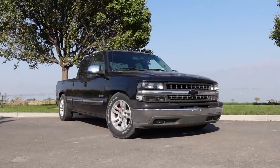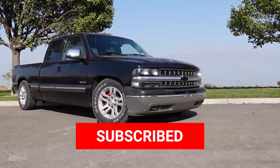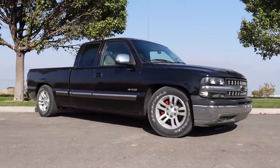Now, this is a 4.8 liter and it makes a lot of high RPM power. It spins up to like 6,500 and it does not make a lot of low speed torque, whereas by comparison, my other truck, the UglyTruck turbo big block, makes a ton of mid-range torque, but it only revs out to like, I mean, I shift that thing at like 5,200. So a gear ratio like a 4.30 actually would not be a good choice in that truck.